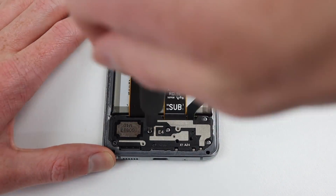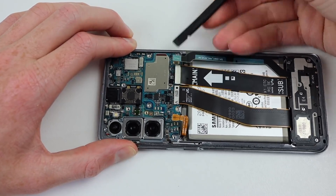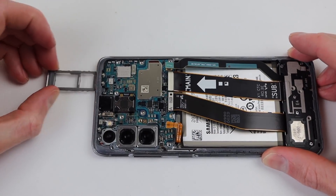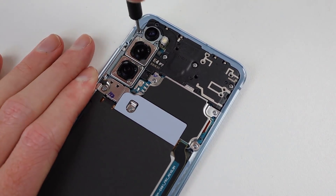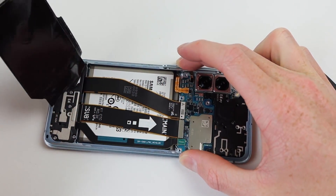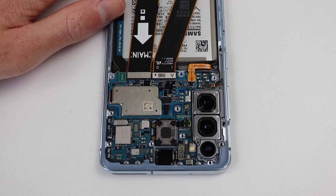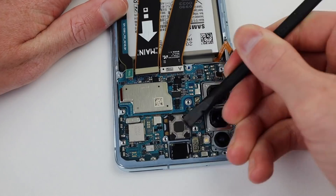I'll screw back in place the speaker assembly so we can move up top and remove the motherboard. I'll start by disconnecting all of the flex cables connecting to it so we can pull it entirely out of the phone. In doing this, I'm going to be able to swap the motherboards between our two phones to see whether any issues arise from the original components being replaced, including the rumoured camera issues. I'll need to get the other motherboard out from our blue S20 first, so I'll repeat a similar process by unscrewing the wireless charging coil and antenna. After removing the SIM card tray, only one screw and a bunch of flex cables holds in the S20's motherboard, making the removal process just as easy as the first time.